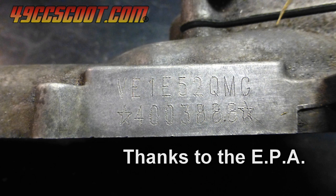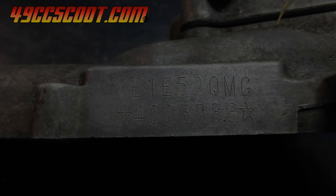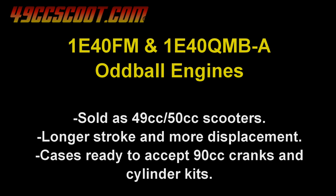Some have said that they are no longer being imported, while others claim they may still be able to get a few. The only other option that I know of for a long case that should accept a big bore and stroke is a 1E40 FM or a 1E40 QMB-A engine. They were sold as 49cc's but use cases ready to accept larger bores and strokes.